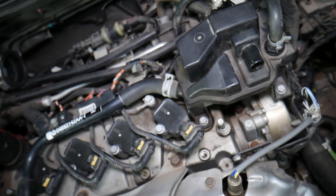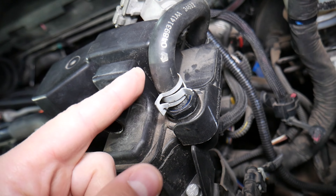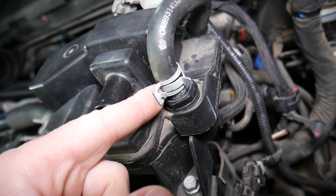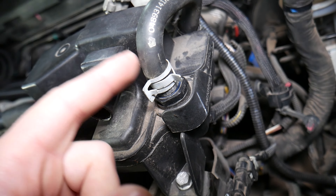Check the gasket from the intake manifold to the cylinder head as well. Now, two things that most people never check: one could be a failing PCV valve. If you check your manual, you should change it at set intervals — around 60,000 miles here in the US for some models, some are 40,000, some are 80,000.